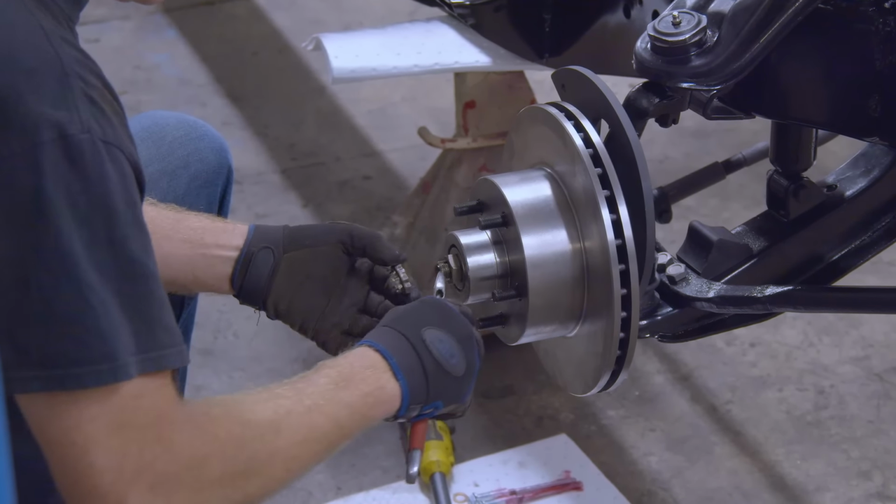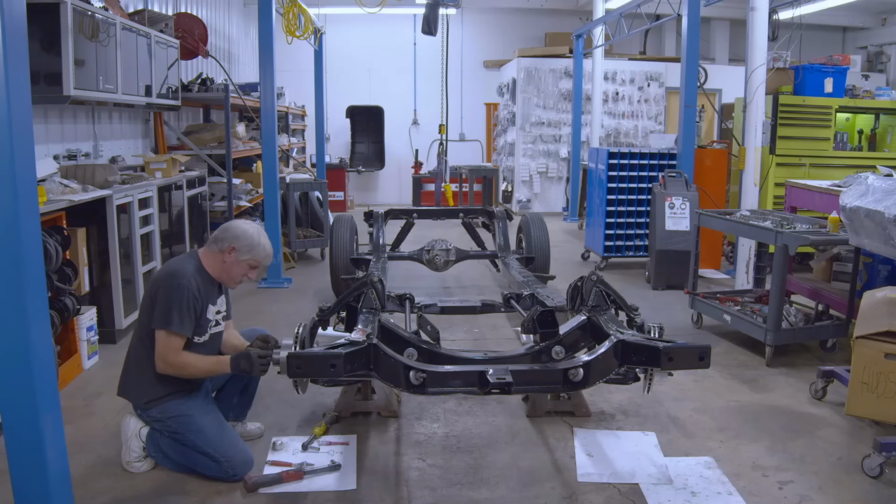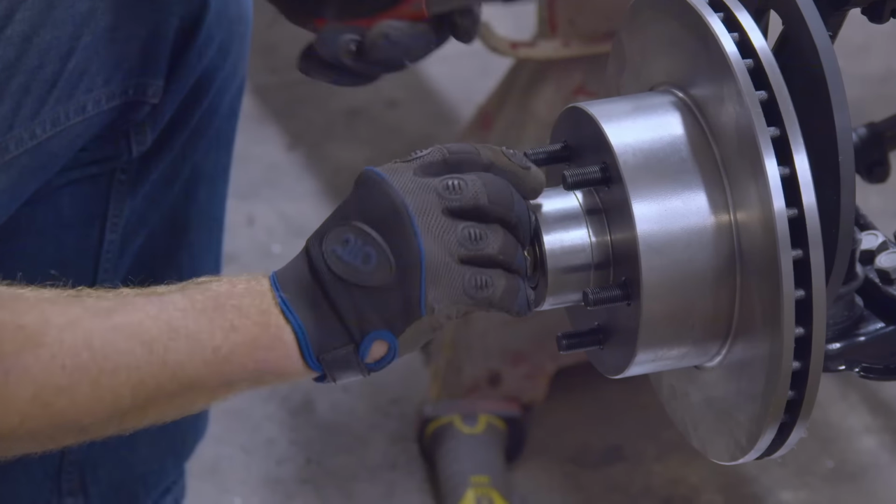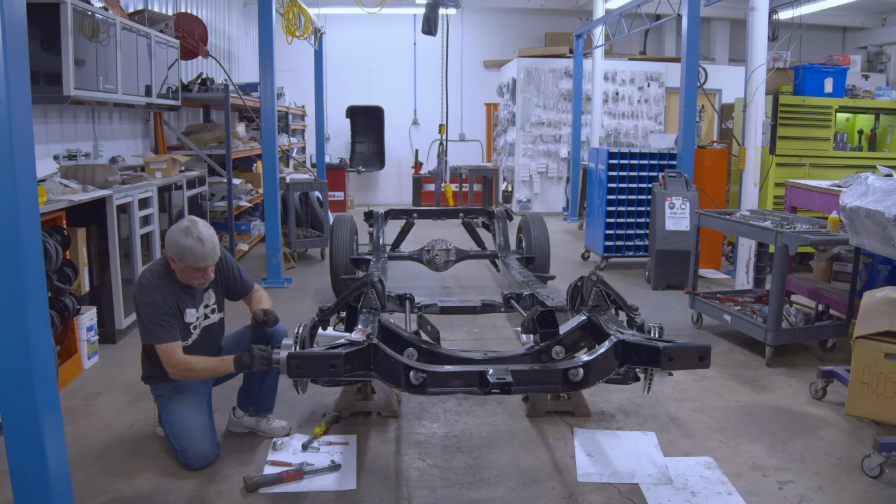I really felt like the disc brakes were important when you consider the fact they say a front brake on a vehicle does about 70% of the stopping. That's a lot to be putting on a pair of old shoes with adjusters that aren't automatic, and they just flip around and lock up and try to kill some poor driver going down the road.